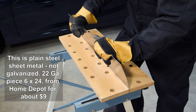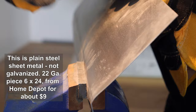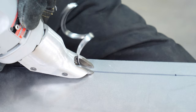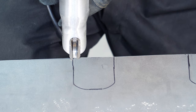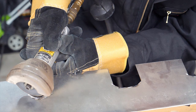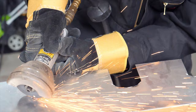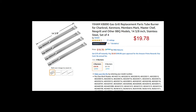Then it was time to fabricate a new heat shield. I first tried bending it in a sawhorse tool, but it didn't work well. I then resorted to using a vise and hammer to bend the metal. I had to cut off a strip the full length of the piece — fortunately, I happened to have an electric metal shear that made fast work of this cut. The metal needs to be notched where the heat tubes go; mark the locations with a marker pen, then start cutting. I finished the rounded tops of the cutouts using a pneumatic cutoff tool, which made a lot of cool sparks, but you could probably use good tin snips to get the job done. The fabricated heat shield came out looking pretty good.